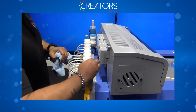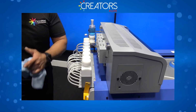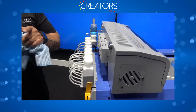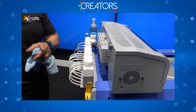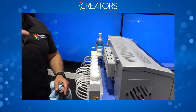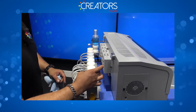Once you're done, of course, remove your cup. You're going to grab your liter of ink, or whatever size you're buying. Make sure you swirl that even longer than these other ones, because that bottle has been sitting on our shelves, has arrived at your location, and you probably have it on your shelf too. So that settlement is going to be way thicker, so make sure that you swirl that a lot.